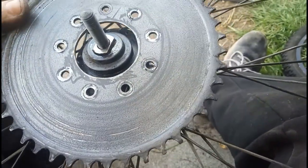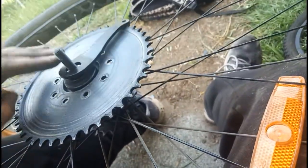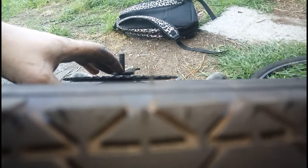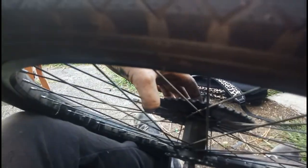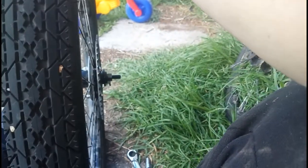We get plenty of clearance there, but I don't think the chain is going to clear the tyre. I've only got three bolts in there at the moment, just in the middle of every little crescent plate. I did that because before I go too far I want to see what kind of clearance we're actually getting. It looks tight, but we're going to throw a chain on there and just see if we can estimate what it's going to look like.